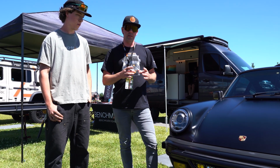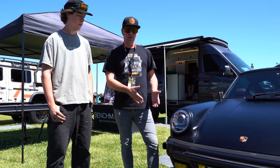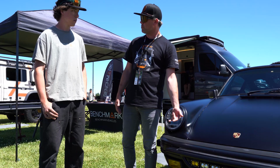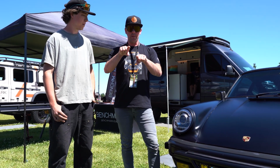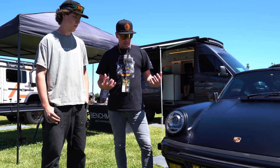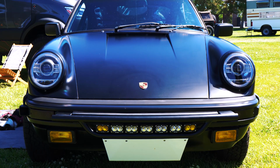We used a European spec solid front tube bumper mount, chopped that 1.5 inches, Noah welded it back together, and then we bolted that to the unibody chassis here and ran those bolts exactly. We didn't really have a lot of room for error there, so there's quite a tight tolerance. And those bolts, they're not straight, they're slightly askew. So we had to match up that pattern with the front of that block to really suck everything together and sort of hold the front end of the car together. Those blocks are really what holds this aluminum bumper to the body.